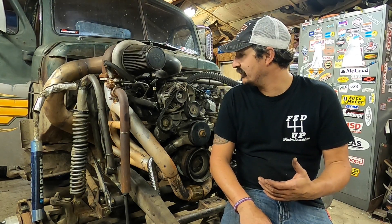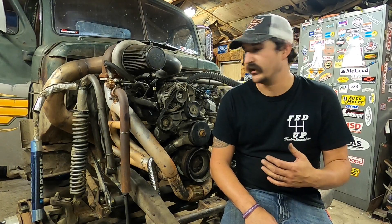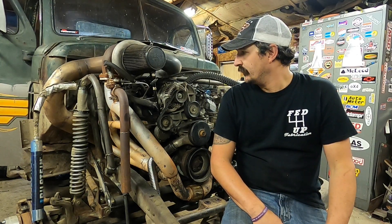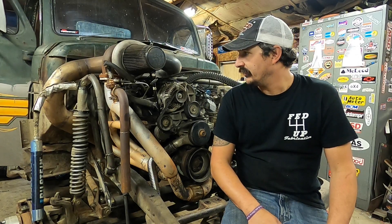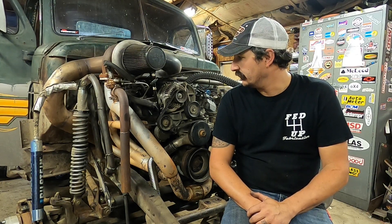A lot of the safety features are really nice. You can set it up so that if intake temps get too high it pulls timing, if coolant temps get too high it pulls timing — basically set it up to save the motor. I didn't have those set up and still it honed in on the fuel I wanted and ran great. I've turned all the safeties back on now because I don't want to blow it up on the street. It has safeties to recognize if a wastegate fails, a fuel pump fails, or an injector dies, and it'll feed that information back or just shut it down. I've literally never tuned anything before outside of a carb, and this thing makes damn good power. I had one O2 sensor die on me, and that was about it for issues.